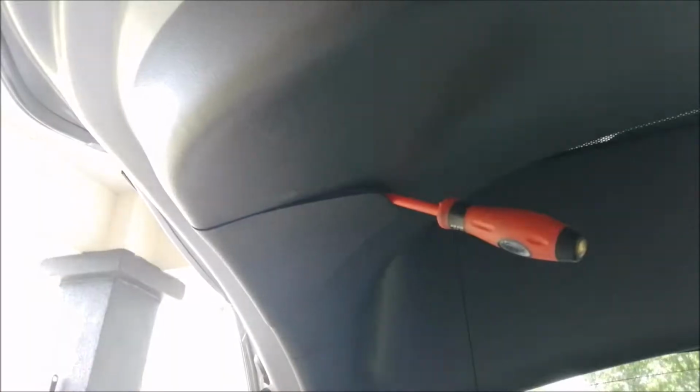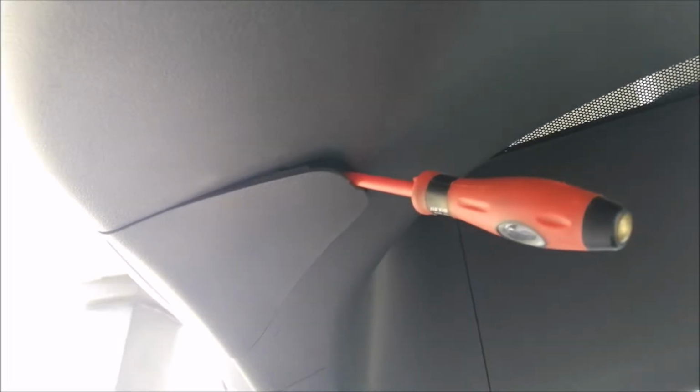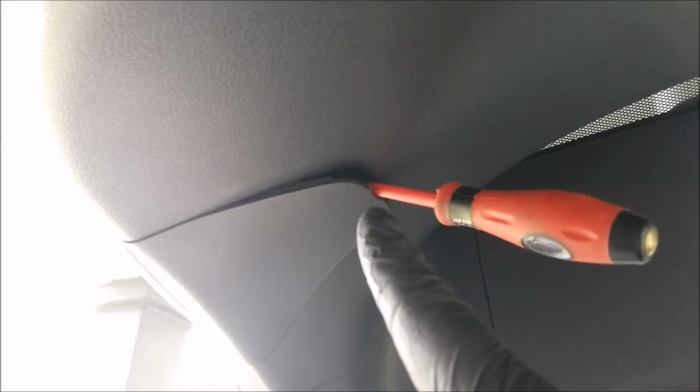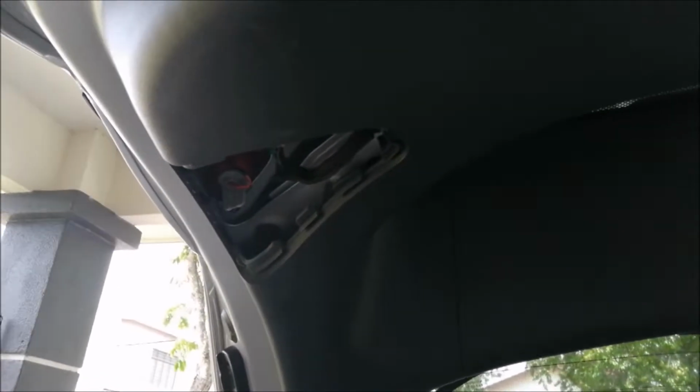the work now. Okay, so the first thing is, this is for the Hyundai Ioniq model. Put your test pen into the slot on your boot at the back, right? This slot. Slowly put in your test pen and pull it down. The cover will come out, okay? Obviously you just hold it, because I'm holding my camera, so the cover will come out. So you do it on both the right and left.